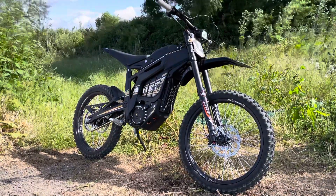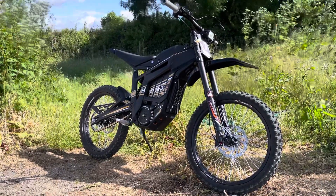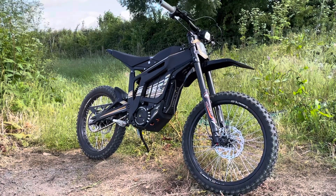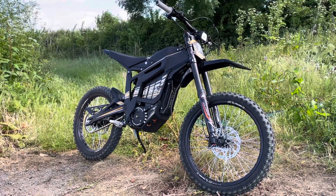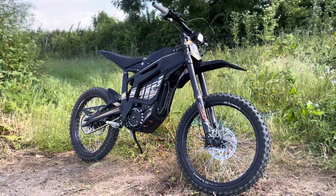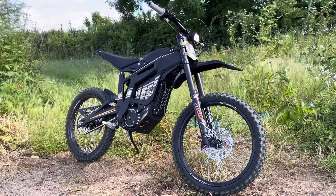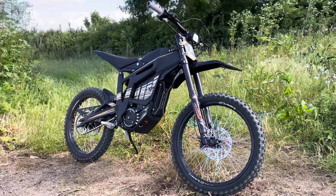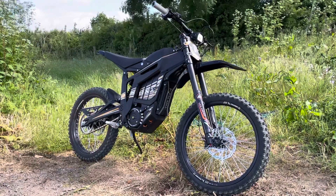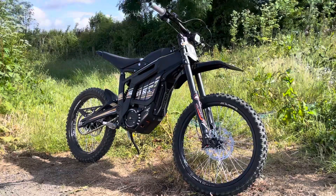This is the off-road version with a 3000 watt electric motor. The road version can be ridden on an AM license because it's restricted down to 30, but this can be de-restricted — it's a really rapid thing. It can be charged in about four hours using the built-in charger, the battery can be removed to charge as well, with a range of approximately 63 miles. In eco mode I would imagine you'd knock about 20 miles off that in full power, which of course if you were using this off-road you would want.